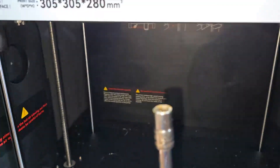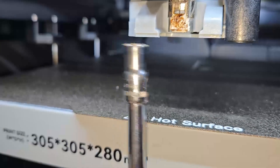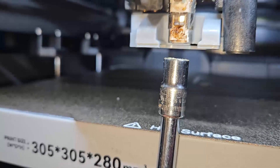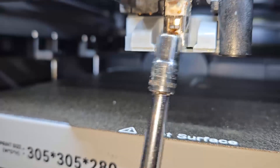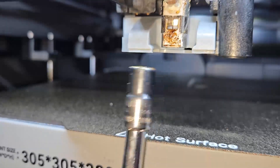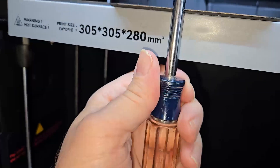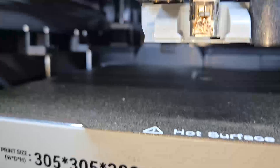but when you flip it over, now you're turning counterclockwise. So if you followed that logic, you would actually be tightening it, and you would do some considerable damage to your heater right here. So what you want to do is slip it on and turn this way — righty-loosey, because it's inverted.